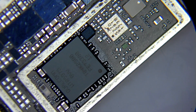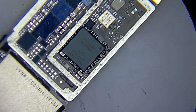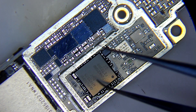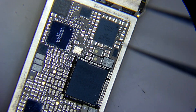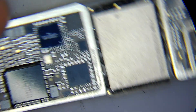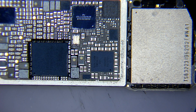If we get this phone fixed, that would be great. If not, you'll need to check all the output voltages from the PMU baseband and also check the WTR transceiver itself, and of course the baseband — though it's very rare for the baseband itself to be the issue on the iPhone 8, 8 Plus, and X-series. But always check everything to be 100% sure.